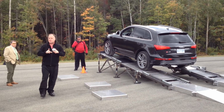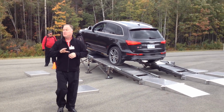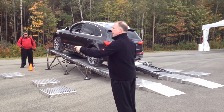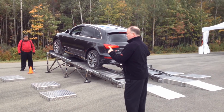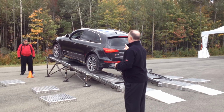We've got a mechanical system that flushes out what's happening north-south, sends torque to the front. The front diff is open. We can get a little bit of wheel spin. We mitigate it by using EDL, the ABS traction control, and it sends the torque to the one tire that had not great, but okay traction, and it walked the vehicle up.